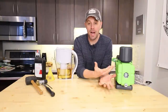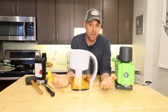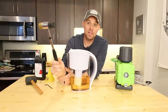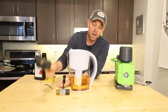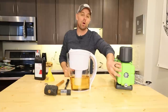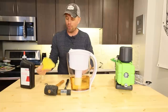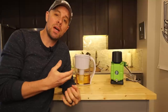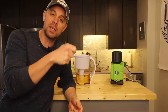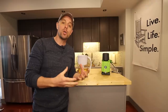To clean out the inside of a vacuum pump, you're going to need the vacuum pump obviously. You're going to need your oil filter — you might as well drain the oil into a filter. If you're going to discard the oil, just some kind of container. I'd also recommend some type of soft face mallet, like a rubber mallet — something that's not going to mar the pump, but helps get that front cover off. You'll need fresh oil, a funnel, and a four millimeter Allen wrench to get the case off. If the inside is really gummed up, you'll want a soft bristled brush like an old toothbrush. You might also need a cleaner like carb cleaner or brake cleaner — something that evaporates and can break up the gunk inside.